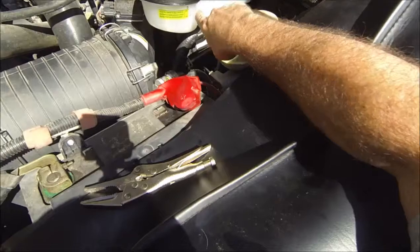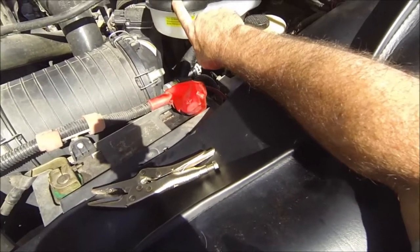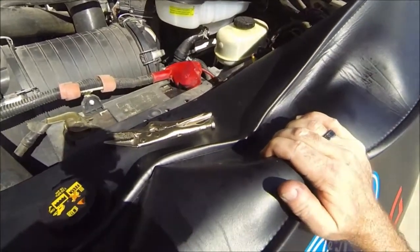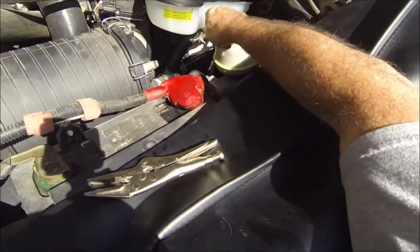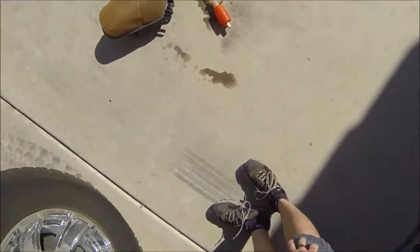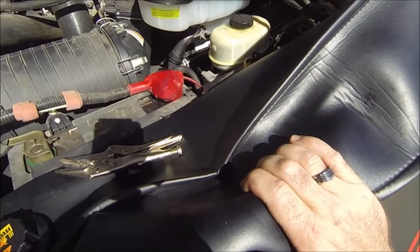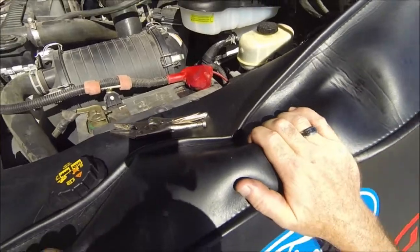I need to make sure all the air is out of the lines. The level will probably go down. Since I pumped it out I know how much liquid was in the reservoir, and I know I lost a little bit — probably less than a quart on the ground — so I'll add a little coolant. This reservoir is actually pretty cheap at RockAuto.com compared to buying one at the dealership. I also like that this one's more of a clear color. Thank you for watching — I hope it helps if you have to replace your coolant reservoir on your Ford. This is a Ford F-250 with a 6.0 diesel.